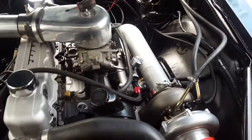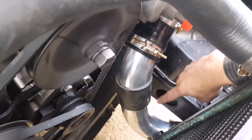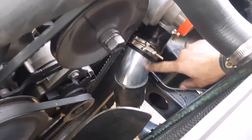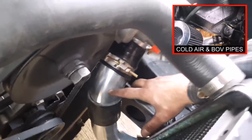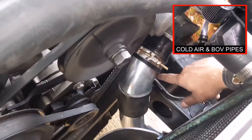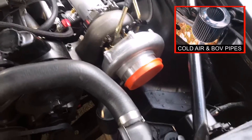Next I want to get the bottom of the turbo hooked up to the existing cold air side. The out pipe from the turbo is now sort of attached — I need to get some more clamps. As you can see, it's connected to the two and a half inch outlet on the turbo, then a reducer coupler that goes to three inches and down. The air filter was originally here during the cold pipe setup, but now I've put a short 45-degree pipe right here so it goes right into where the turbo is sitting. I'm pretty happy with that setup.